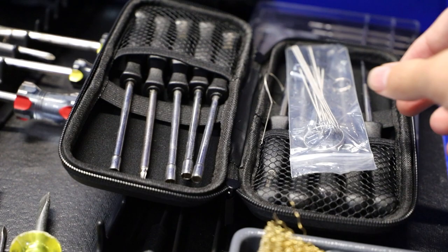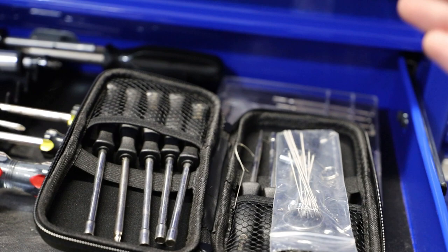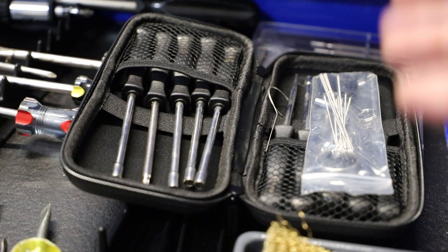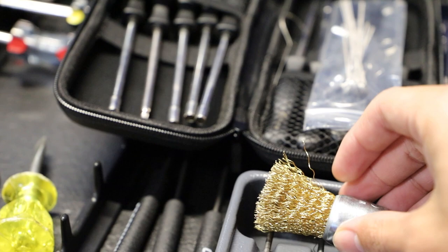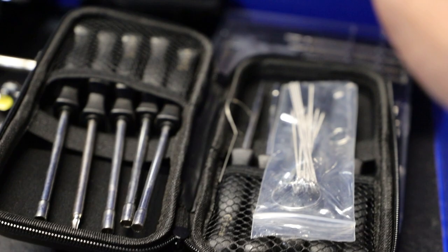Everything actually looks good on this bike — I knew going in this carb didn't have any issues, but I wanted to bring you guys this video. If you do have dirt in the jets, go ahead and clean those out with carb cleaner the best you can and make sure that hole is free and clear. If carb cleaner isn't cutting it, you can buy toolkits online made specifically for cleaning carburetors — they come with little mini brushes you can gently poke through the jets. Be very careful, as the jets are made of brass and can be damaged easily. In a pinch you can use a wire brush and bend one of the individual wires to poke through the jet — again, be very careful.